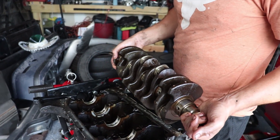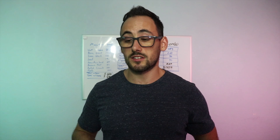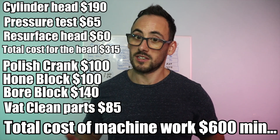Then there's the crankshaft - when we dropped everything off they thought the crankshaft looked good. They're going to micro-polish the crank, which you could technically do yourself, but they'll be able to tell us what bearings we need, whether we need standard over or undersized, and if it's within specs. It's an important process. Once you drop your parts off at the machine shop, you're already in it - we dropped it off and we're already in for about $600.